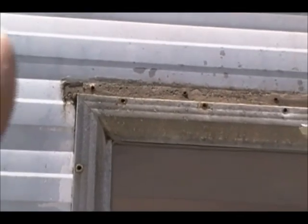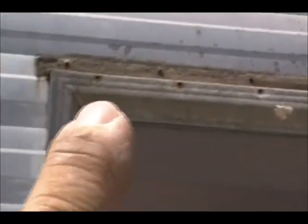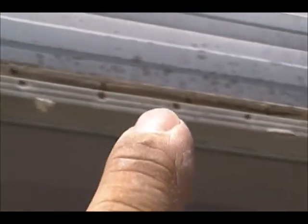And after a few years and things, but what I wanted to point out was the butyl tape. You know, the butyl tape, look at how dry it is, and it didn't even stick. I mean, it is dry, so yes, a lot of water seepage. That's why it's so very important. Every few years you've got to replace that butyl tape. You want to keep your windows clean, maybe reseal them, things like that. Well, these are things that you want to do.